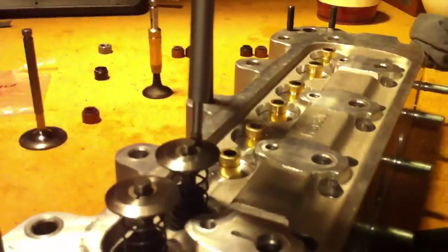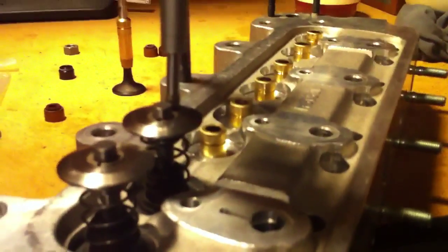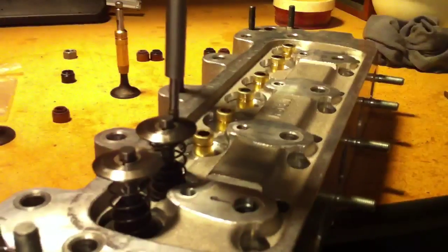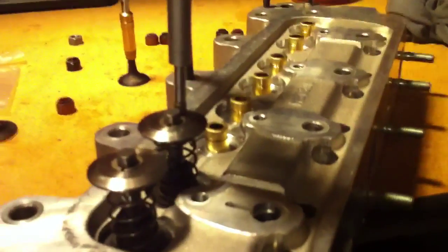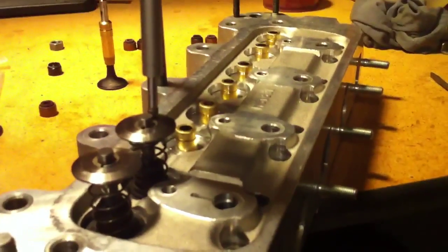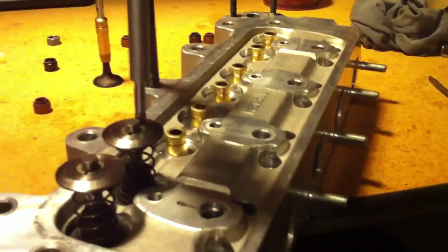So there are a number of things we're dealing with here. What I'm going to try next is to see if there's room to machine these valves down — if we can gain maybe 30 thousandths, that'll give us the clearance to the seal. All this stuff takes a bit of time; every time I take it to a machine shop it's a few days to get it done and see what the result is. I know the racing season is going on and I'm doing the best I can to make this all work so we have something that's going to hold up and be an enjoyable engine. I will continue these updates and hopefully have a solution in the near future.